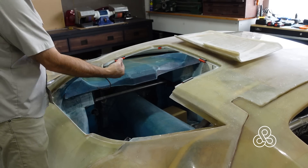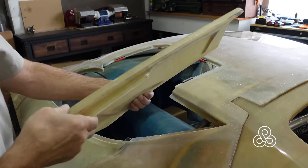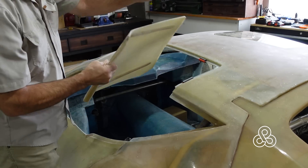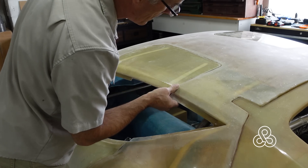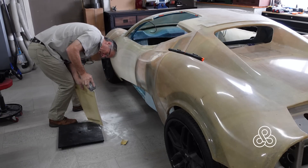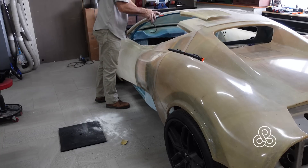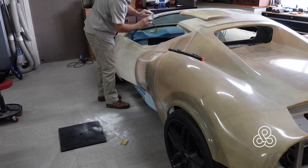Most of this is going to be about the hinge and how we're going to attach this door, but part of that has been the separation of the door into a couple of pieces. This roof panel, which is now changing, is going to have the glass coming up against a rubber seal beginning here. This part here was actually an extension down into the lower part of the door, so we've had to cut that out. We're going to add an extension to basically extend that flap down to accept the rubber seal. I'm just going to check all the fittings — this is just a rough fitting. We'll go back in and do all our panel gaps very particularly in the end. Once we get all these things fitting just the way they need to be, we have to create a little flange there to put this whole system back in to accept the new weather stripping.